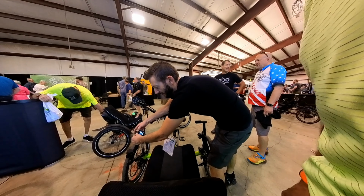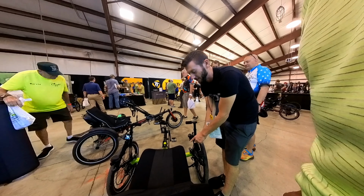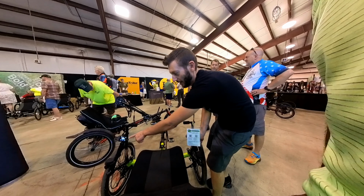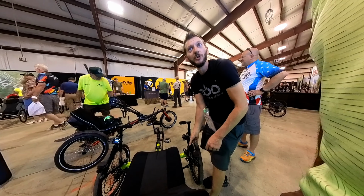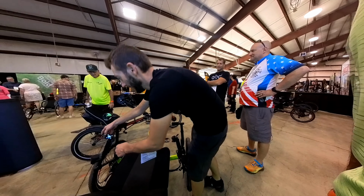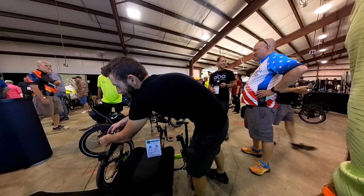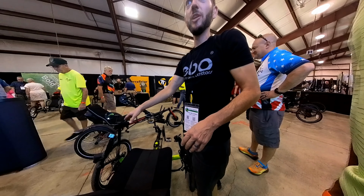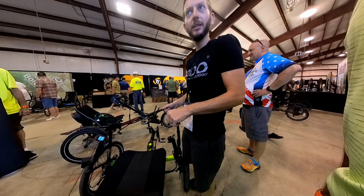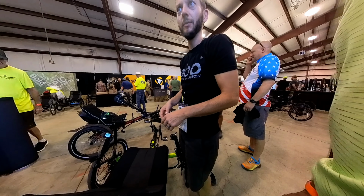So up and down has more power? Yeah. That's pedal assist up to 5. And then you've got a thumb throttle. The brakes are e-brakes, so when I pull that brake, it cuts the motor. You can't accidentally throttle something. And if it's not behaving exactly how you want it, we have all these micro adjustments so you can tune how sensitive that pedal assist is, how the throttle activates, and all of that. It's very customizable. There's no computer or matrix you have to log into or anything.